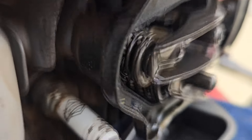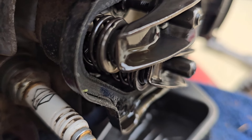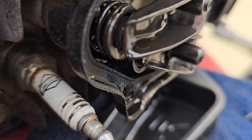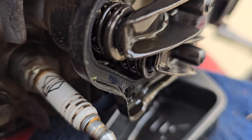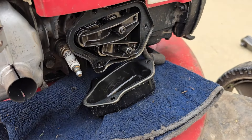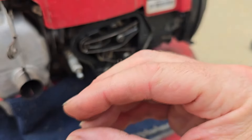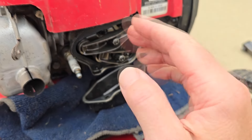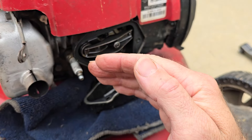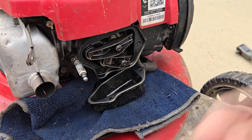Now we're on our compression stroke. And that was our exhaust. Now our intake goes down, and there we have just a little bump on the exhaust — compression. We get rid of the exhaust, the intake goes down, intake comes back closed, and then the exhaust goes down just a skosh and comes back up. This only works when you are pull-starting the engine. As soon as the engine starts running, that little spring-loaded lobe on the camshaft on the exhaust side will fly back up and out of the way so it no longer activates the valve. When the engine shuts off, the spring pushes that little lobe closed, and as you're pull-starting, it will hit that lifter to release compression — so it's a little smoother to pull. That's how it works in a nutshell.